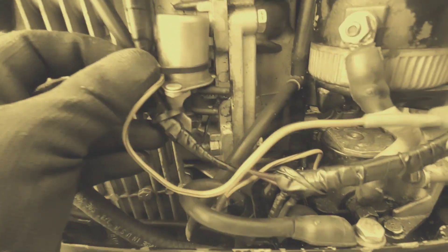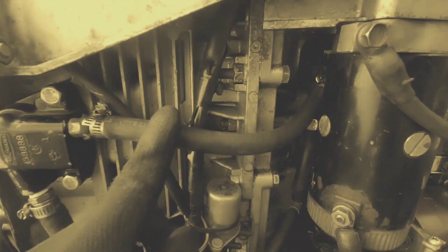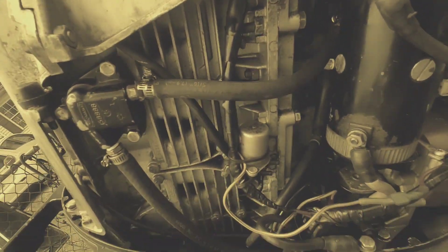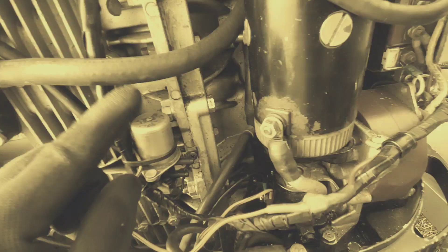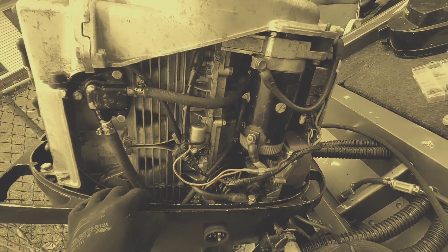What I'm going to do now is splice the fuel line. This is the main fuel line from the fuel pump. When you prime the bulb and the carbs are full, once you click the enrichment valve, the pump is actually going to pump fuel through here and hit this vein right here — basically pumping fuel directly into the crankcase to make starting easier.